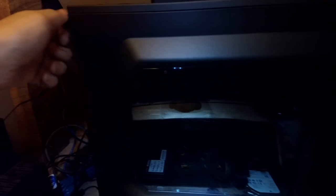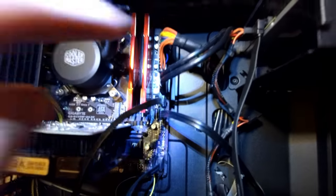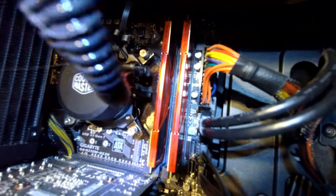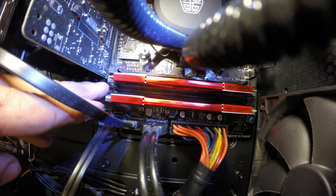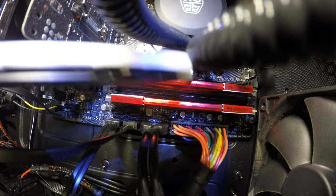I have it in this closet here to make it quieter. Before working on it, let's just unplug — actually we can just turn that off. The power supply is off, I'm not going to make a big deal out of this. Here's the memory right here — I've got two of the four spots used. Whenever working on a computer, you want to keep yourself grounded to the chassis to prevent static electricity from building up. This only plugs in one way — it looks like it goes this way.